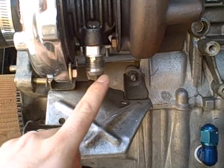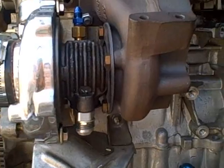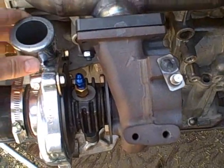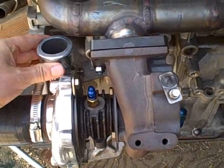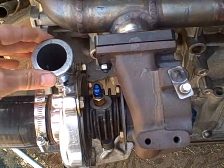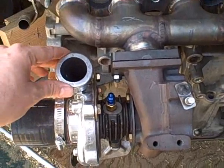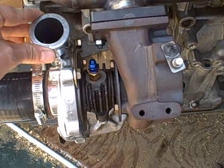After it is, you can go ahead and tighten up the bolts on this side, and that'll lock the center in. Then, when you put on the intercooler pipes and whatnot, you can rotate this housing here so that it clears everything — doesn't hit the exhaust, doesn't hit the firewall, or wherever it is on your car — and then lock this section into place as well.